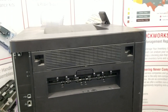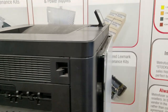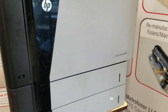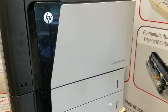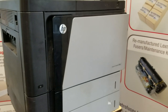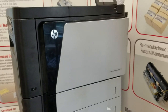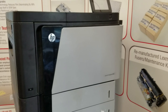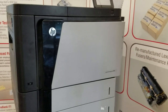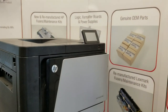A couple of repair notes on this printer: the OEM recommends a 200,000 page yield between preventive maintenance cycles. There is no manual reset for the fuser page count on this printer — there is a fusible link technology built in that will automatically reset the page count. However, you need to have the printer off when installing the fuser maintenance kit, or it will negate the link technology and possibly cause further issues. So make sure the power is off.